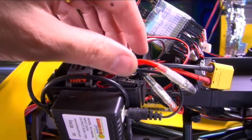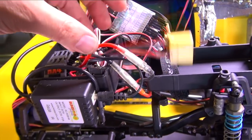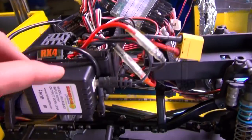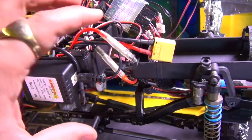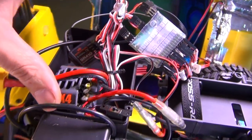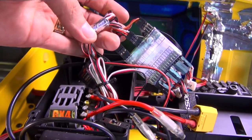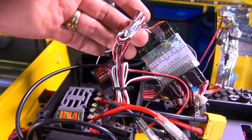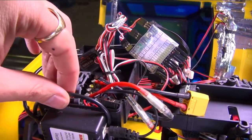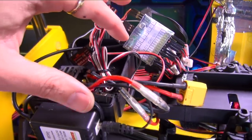This is going into my receiver. This is my ESC right here, which has the battery plug on it and the two motor wires, and normally this wouldn't be here. This is for those strip LEDs, and this is a light controller for a remote control I showed in the last video. If there's anything to say to you guys, it's just try to keep your wires neat. A lot of people can use wire loom, but I find that the leads can be so long on some of this that the loom isn't adequate enough, and then you've still got all that mess in here.